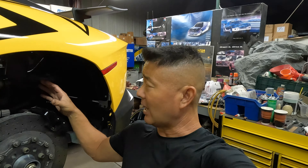Then it's time to address working on the shock. There's a bolt on the inboard side that I actually raised up because on the passenger side it comes down on top of the shock, and when I was trying to maneuver to get it out, I scratched it up a bit. If you take a 13mm socket you can just back that out and bring it up far enough to be out of your way. As far as the Novatec kit, it's top tier — all the parts are very high quality, the machine work is impeccable, and everything arrived packaged very well.